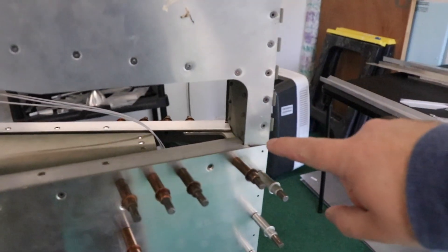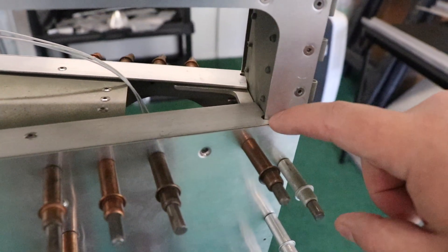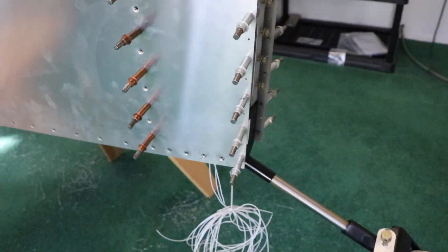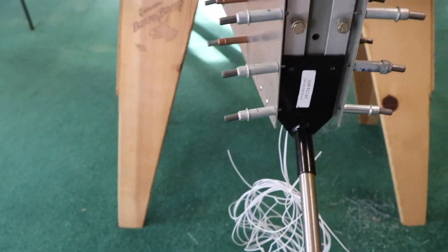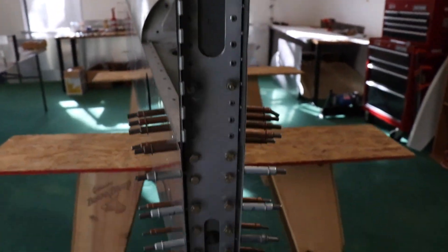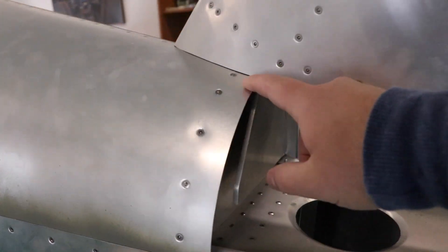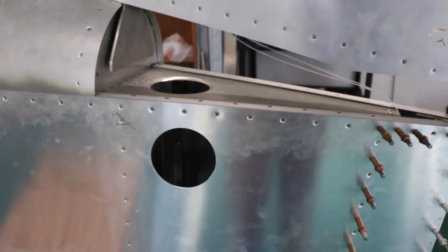I had to grind out some really small spots in here, but that's okay — that's what it's designed to do, top and bottom. Then I got some of the tailwheel holders to pop on. Now that it's on here I can go back and make sure it's straight, which as of right now it's extremely straight. I also had to grind out some of the skin on here to make sure that fit, which is in the plans as well.